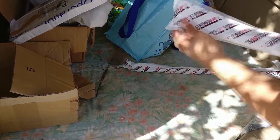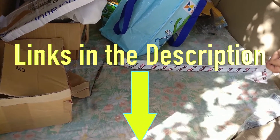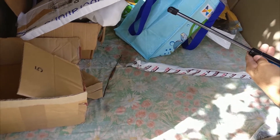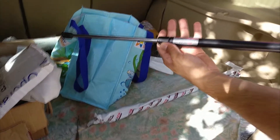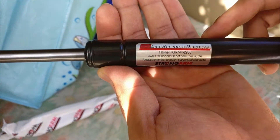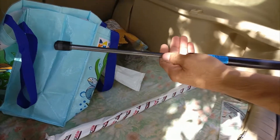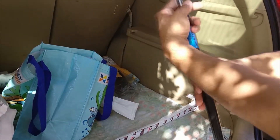I've left a link in the description down below where you can purchase the specific struts for your car. I won't recommend doing a random search for replacement struts because you'll need to know the specific weight requirements for the strut, as well as the length, and in my case, my strut has a slight bend on the end. If you can't find the strut for your car in particular, you can contact the seller via Amazon, which is what I did, and then they sent me a link to the one for my application.